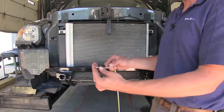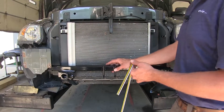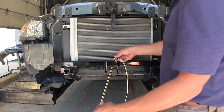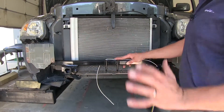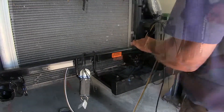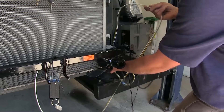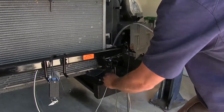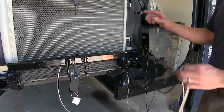The bulb and socket kit is going to require us to run a four-pole wire from the front side of our vehicle at our wiring connector all the way back to our taillights. Once the fascia is back in place, that gets a little bit more difficult. What we like to do is just take plenty of wire that we know we're going to need, run that out, and then we're going to use zip ties to secure this and any other accessories we might need for our braking system before we get this all put back together. As we route our wire, we just want to ensure that we stay away from any sharp edges, significant sources of heat, or anywhere that might pinch our wire. That should do us for our wiring — that's going to get it back here to a safe area. We'll take care of running it to the back of the vehicle once we get our fascia back on.